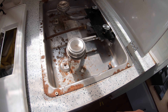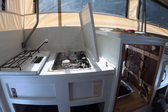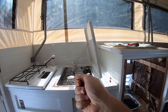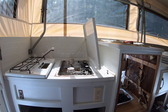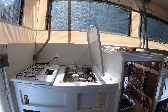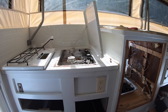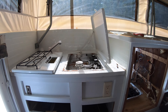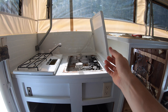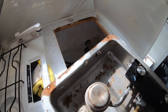I just took the cover off the top of the stove to get a glimpse into how the propane connects. It's got a good bit of rust in it — I guess that's to be expected from something you cook on, but I don't know how I feel about the stove. It would be convenient, but I don't like the way this shield sits so far over it — it would be really hard to cook on. Also, because it's hardwired into propane, if we ever wanted to cook outside and not get food smells all up in the camper, that's not really an option with this stove. So if I end up rebuilding the whole cabinet system, I think I'll just get rid of this stove, sell it, and put in a traditional camp propane stove that can be used on this countertop or taken outside.